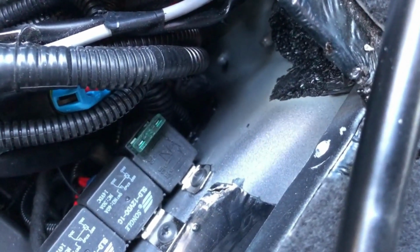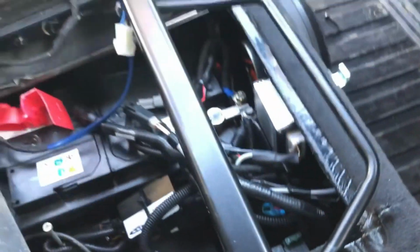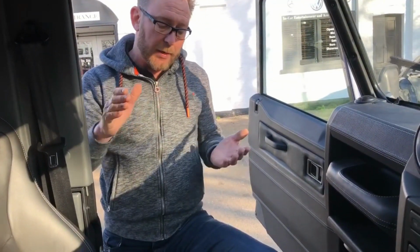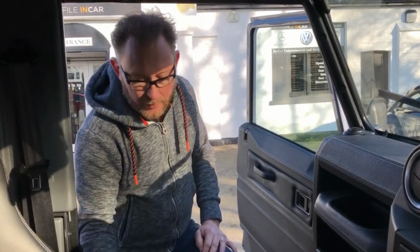It's definitely not okay. Those fuses are made of 2 plastic shells pressed together over the inside contacts. When you bend it over at 90 degrees, the plastic shells pop apart. I've seen it loads of times. So you think the fuse is going to blow. Well, no, it won't. One side of the fuse is going off to feed the car, and that's okay. The other side of the fuse, which is then pressed against the bottom of the metal, goes right back to the battery. So once again, what have you got? You've got a potential fire. It's bad. So we've relocated that and replaced the fuse and made that safe.